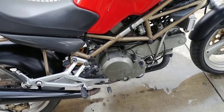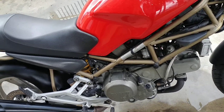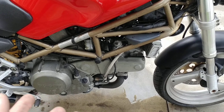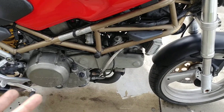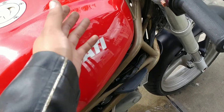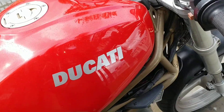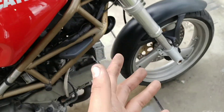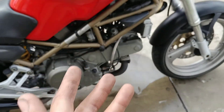I haven't had any issues with it. The frame — these Ducatis are pretty easy to spot when they're bent, because the frames are really sensitive; they're tubular. You can spot it by lifting up the tank, which I will show you if you want, so you can see the whole front end. It's nice, there's no dents in it, hasn't been re-welded or nothing like that.